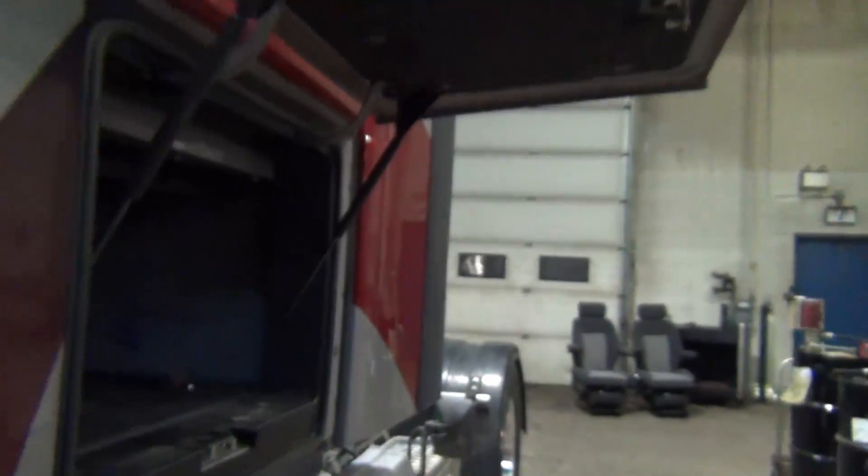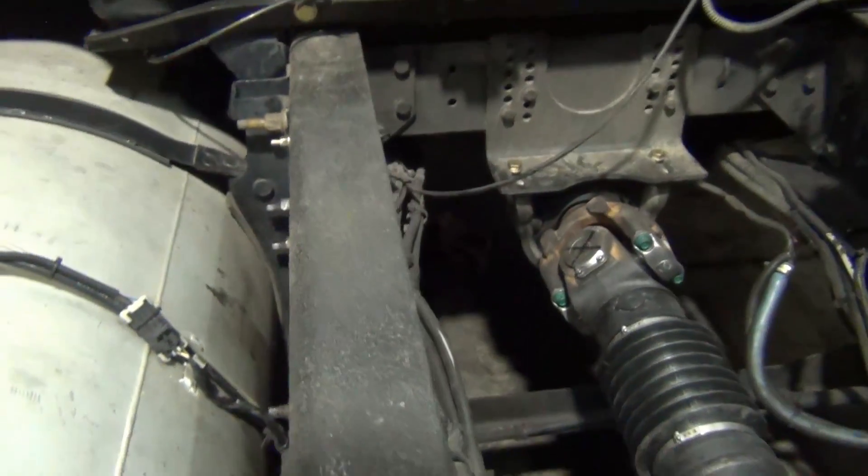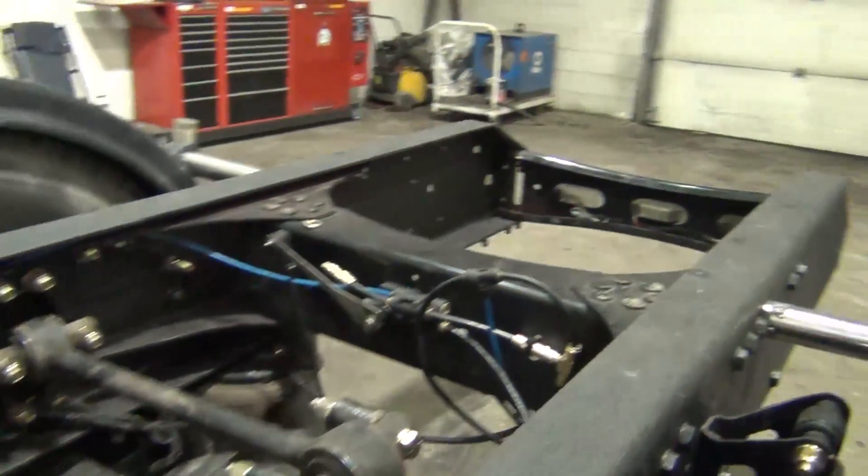The place I'm referring to on the driver's side is right here — this box. We gain access from here inside the driver's side. Likewise, on the passenger side there's a ring, and when you pull it while lifting the door it releases. Jack already has quite a bit of electronics in here — a 3,000-watt inverter and a power supply for shore power. What Jack would do is bring the green cable up from underneath, place his Jackalope in here, and then the trailer return would go back down, out of that location, and run along the frame back up to the hitch location at the rear of the truck.